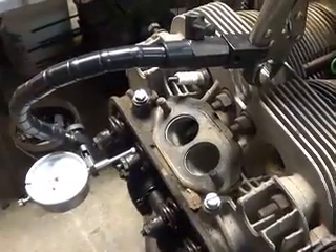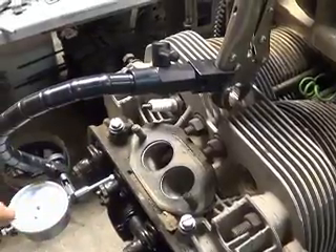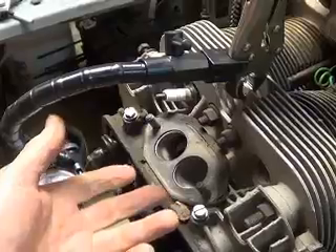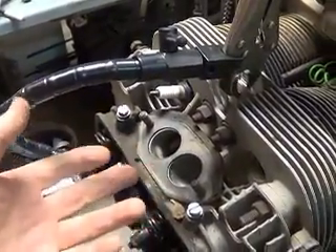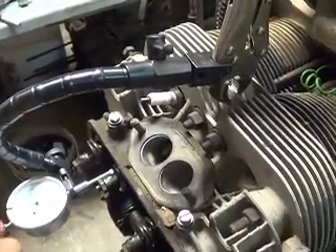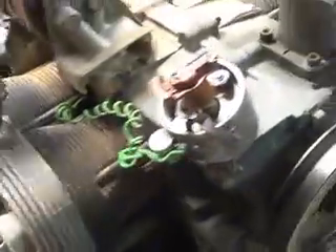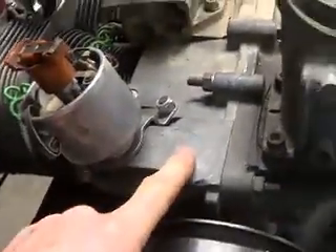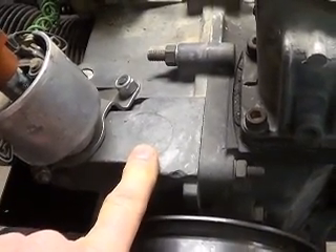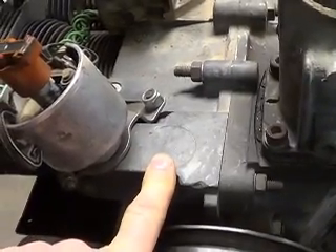The spark plugs looked okay. When you're doing a compression check, make sure you hold the throttle butterfly wide open — or what I do, since I have dual carbs, I just take the carbs completely off. There's no sense struggling trying to reach around stuff. Even in a Baja where the engine's hanging off the back, and I didn't build this engine, it is a later model case because it doesn't have provision for the fuel pump hole — that's what they did on the later fuel-injected models.